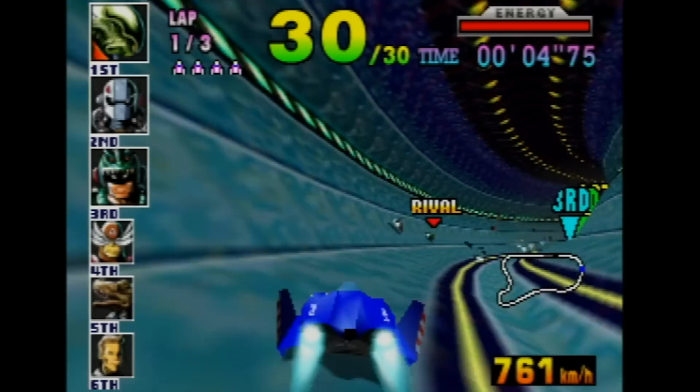And so, like you say, there is this kind of ceiling with N64 video quality, where RGB is nice, but it's not a massive leap over S-video, which in itself is a nice but not huge leap over composite in this case. That's just N64 video. That's just how it goes. I guess obviously with this thing, the need to make it compatible with all systems results in the limit to S-video, but the end result is pretty good.